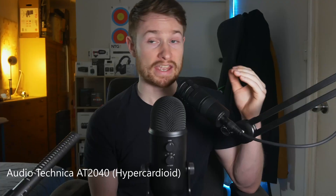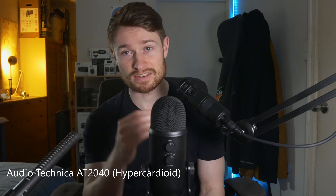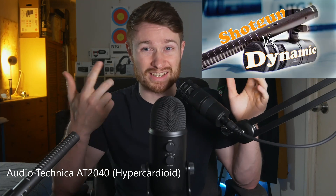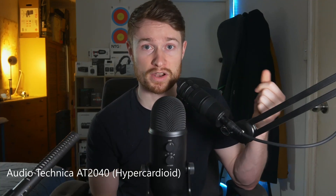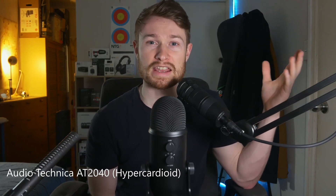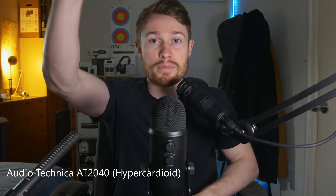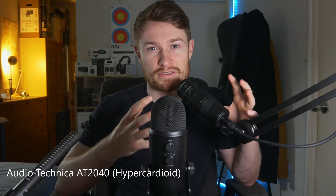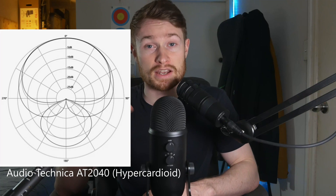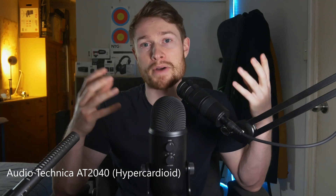This dynamic microphone, the AT2040 from Audio-Technica, has a hyper cardioid pickup pattern. It is extremely directional, so if I come off to the side, you can really notice that difference — I can even see the volume drop significantly when I move to the side. Here is what the super and hyper cardioid pickup patterns look like compared to cardioid. There is a significant difference between them and cardioid, although between super and hyper cardioid themselves there's not a huge difference in the actual pattern of how they pick up sound.